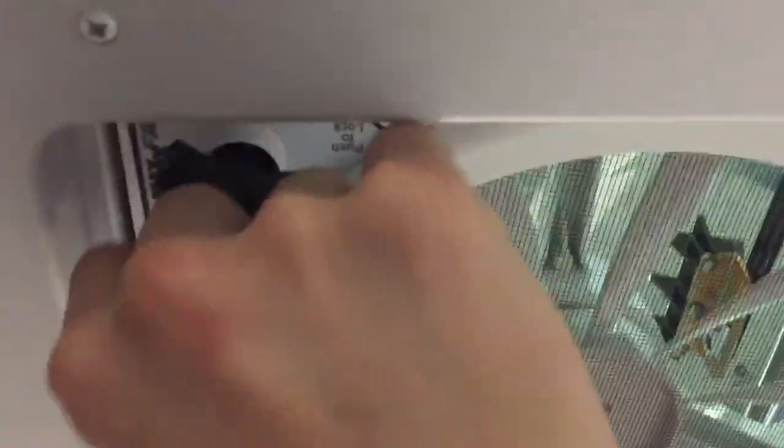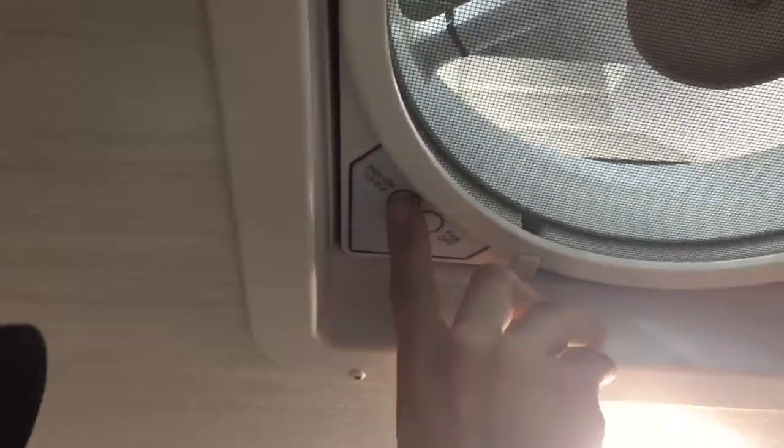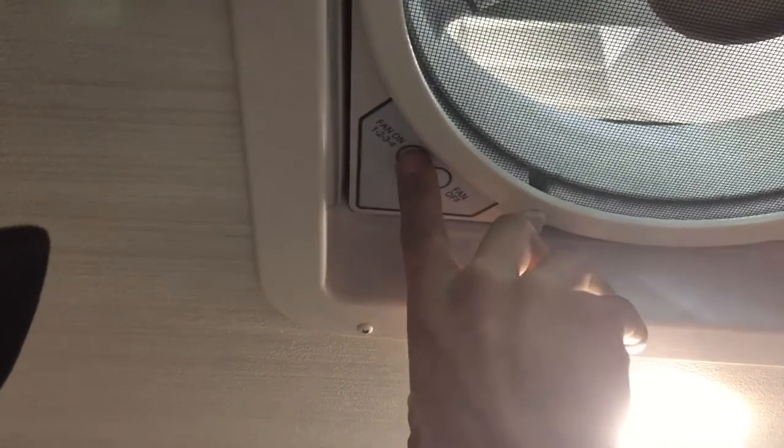In the bathroom, the lights are tied into the interior light switch. Up here you've also got your roof vent — turn that knob to open it up. In the back corner, you get buttons to turn on the fan at speeds one, two, three, and four. Hit it again after four and it cycles back to one. To turn it off, press the off button, then slide it back down, close it up tight, and press the knob up to lock it into place.